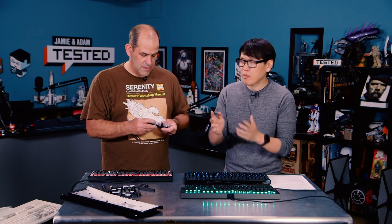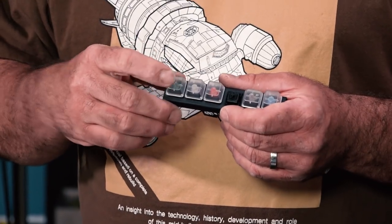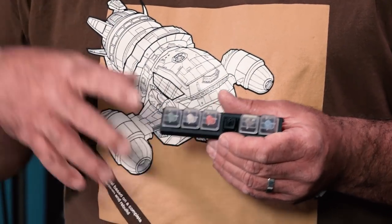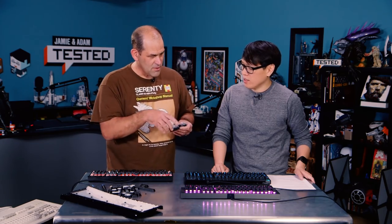Key travel is down to about 1.9 millimeters for the majority of keys, and there's a sensation of how stiff it feels under your finger. The green Cherry switch is really really close to a classic IBM Model M — a lot of travel, a very distinct noise, definite resistance. Corsair is actually the only gaming company that has a partnership with Cherry, and even though they aren't using the exact same Cherry keys, they've developed a new type of key switch.